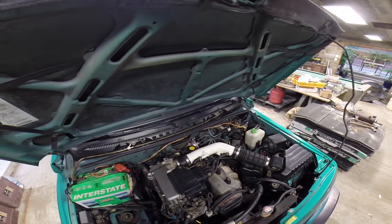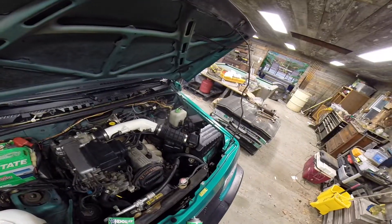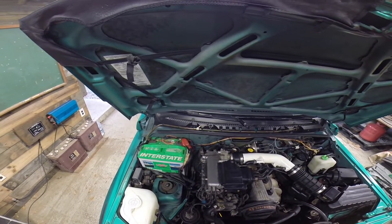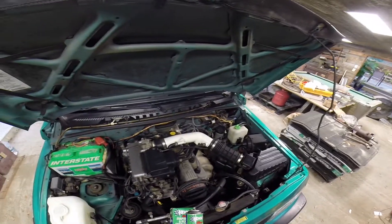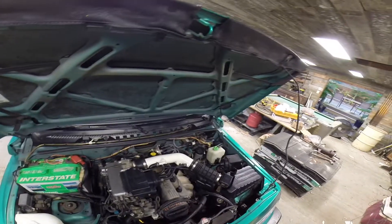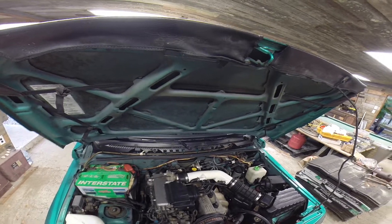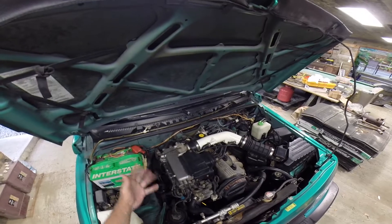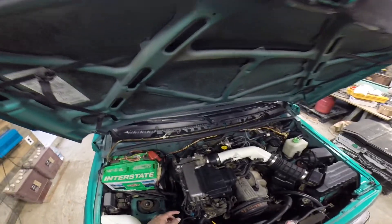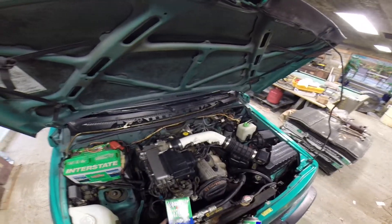I'm not too sure about that just yet — I just cleaned it. The directions say to spray it in there with the engine off and let it sit for 15 minutes. After 15 minutes, start your car up with your AC on low and let it run for 5 minutes. It'll drip out all the stuff after it cleans it.